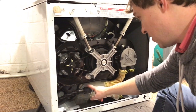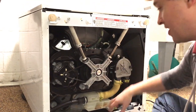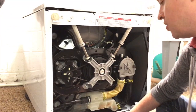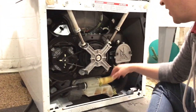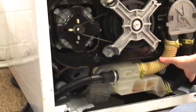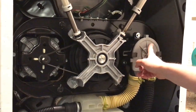This is where the drain pipe is, so all your water in the washer will come down into this little reservoir. This is the pump right here. So if you were getting a flood error code, what could happen is you might have a clog in your drain pipe, you might have a clog in one of these two pipes, or you might have something jammed in your motor, which is what happened to me.